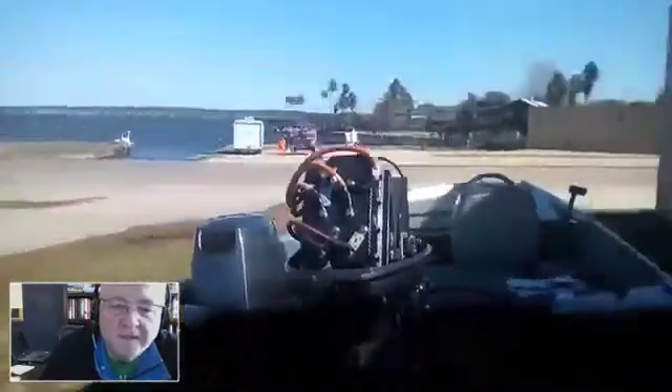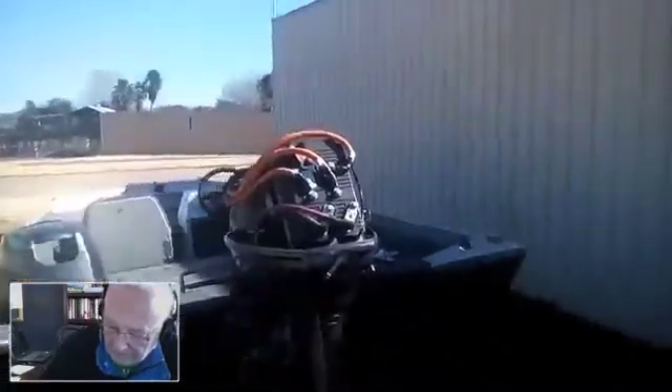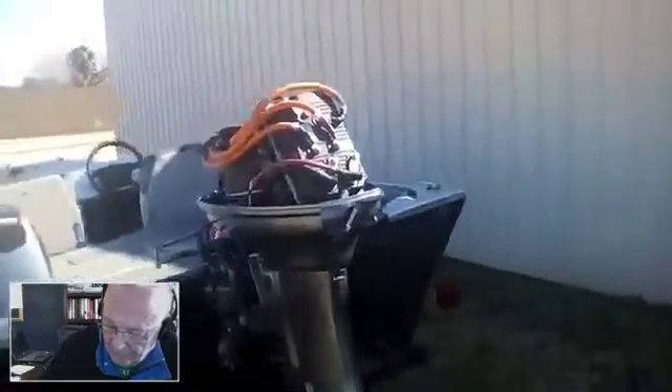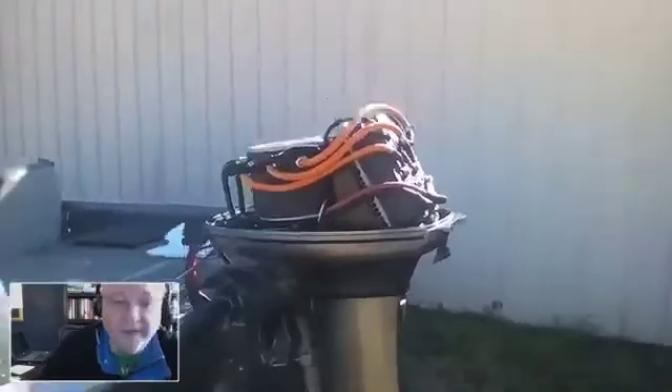The controller is rated at 96 volts and will handle up to 120 volts — at 120 it kicks off. It also handles 240 amps continuous with a 600 amp peak. Right in front of that is the motor — also 96 volt rated, a PM AC water-cooled unit. The max RPM for this motor is 7,500, the rated torque is 50 Newton meters at 225 amps.